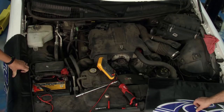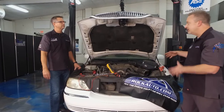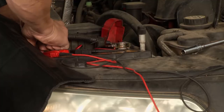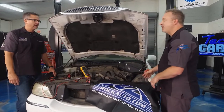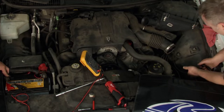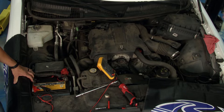A couple things we did, Dave — we put a new battery in from rockauto.com because it's actually running that pump once in a while. We're suspecting. Just topped that off, make sure it's in good shape. These Lincolns and Fords are famous for their air ride system, which is cool, but they're infamous because of all the problems. They're very sophisticated systems and they can run into a lot of things — there's a lot of moving parts. So we've got this pump that is running and is annoying. We will unhook it, take the power out. We're going to delete this thing anyway because it's complicated. We're just going to go back to a traditional system and take this out of the loop altogether.